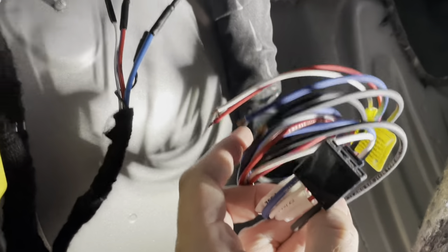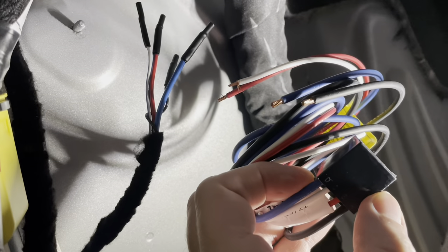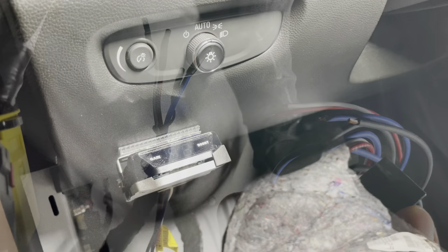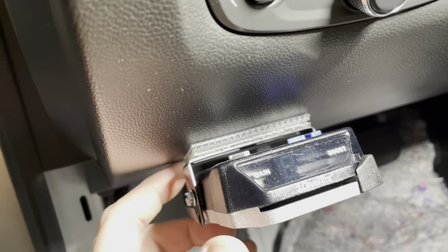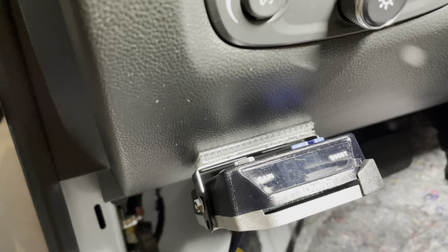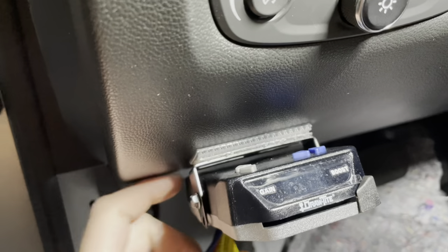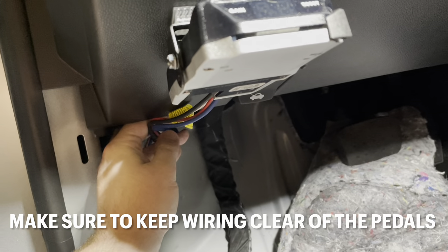I'm going to go ahead and wire this in to the factory wiring. We're going to cut these nubs off here where you have the heat shrink, and then I'm going to use some butt connectors to attach these to the factory wiring, tape it up, and we'll start looking at where we're going to mount our controller. I went ahead and installed the brake controller on the underside of the dash. Instead of drilling holes and screwing it directly into the dash, I decided to try some 3M dual lock — it's kind of like a heavy-duty plastic Velcro — just to prevent having to put holes in a brand-new dashboard. It wiggles a little bit, but honestly it's pretty solid. Now that I know where the brake controller is, we can cut all the wiring to length and get everything bundled up.